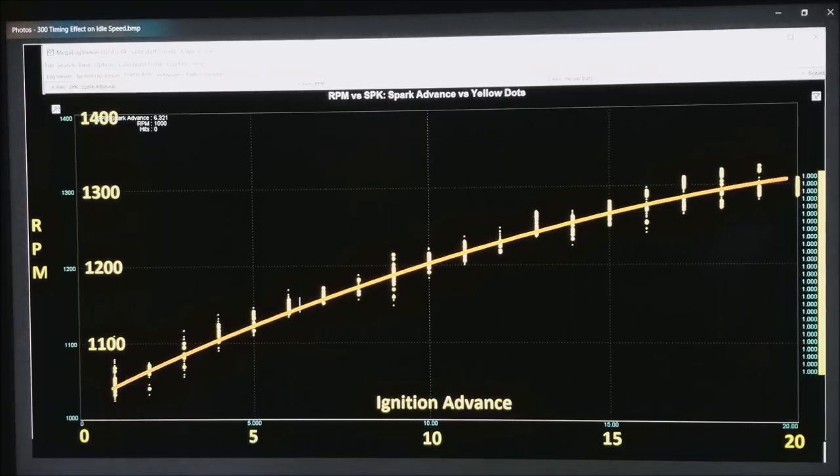This is a test I ran on a different motor, but almost all motors respond in a similar way. I had the idle air controller disconnected and used the throttle stop to give myself 10 degrees ignition advance at 1200 RPM. I locked down the timing in the settings so I could increment it up one degree at a time — starting at 10 degrees, then 11, 12, 13, 14, 15 degrees. Notice how the RPM slowly and very consistently came up as I added timing. Then I went to 9, 8, 7, 6, all the way down to 1 degree timing, and got this curve.